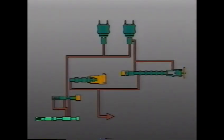Let's examine the third clutch circuit. When the driver moves the shift control lever into D3 or D4, the manual valve is the source of line pressure. It moves to allow the flow of line circuit oil to the actuator feed mode valve. The valve sends oil to both the third and fourth clutch actuators. To shift into third gear, the TCM opens or turns off the third clutch actuator only, sending fluid into the third clutch circuit.